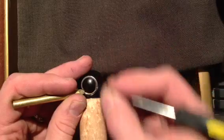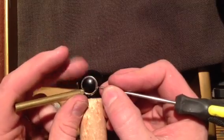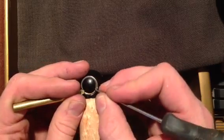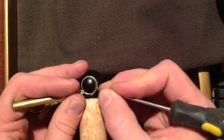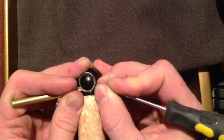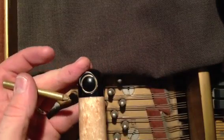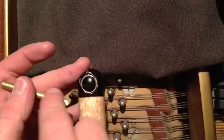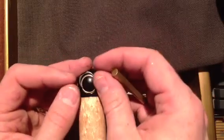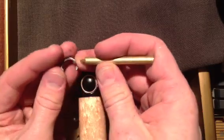If you slip you can scratch up the unit — there's no need for that. I'm also holding my middle finger up against the clip so that we don't have the clip flying across the room. I'm going to push off with my right hand and that clip is going to come right off. When we get to this point, the clip is still being held on by its own tension, but there's no need for the two-handed system anymore — I can just fetch it right off. There's the clip.